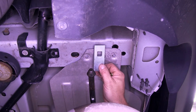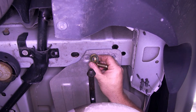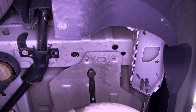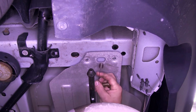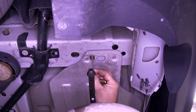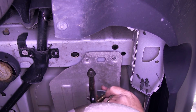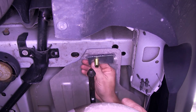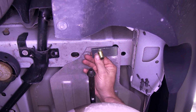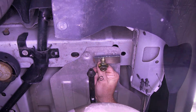a square hole spacer block, and a 1/2 inch flange nut. Now to install our carriage bolt and flange nut into the vehicle's frame, we'll be using a bolt leader or a pull wire to do that. So with our carriage bolt installed in the spacer block, it'll look like this up inside the frame, with our flange nut installed, securing the hitch.